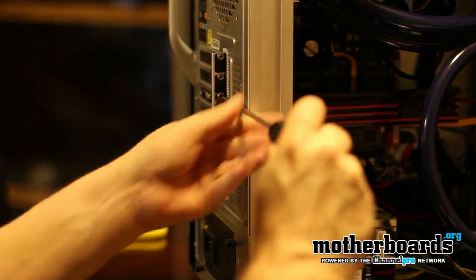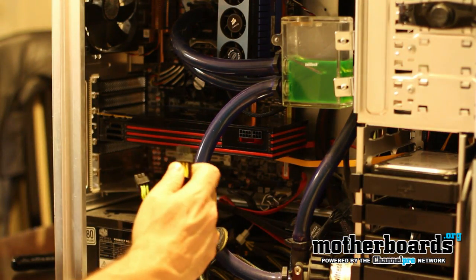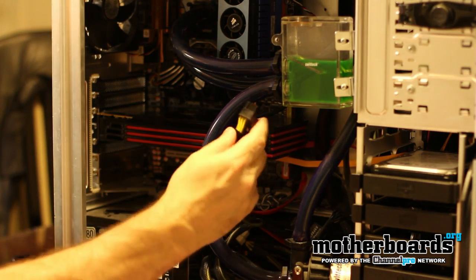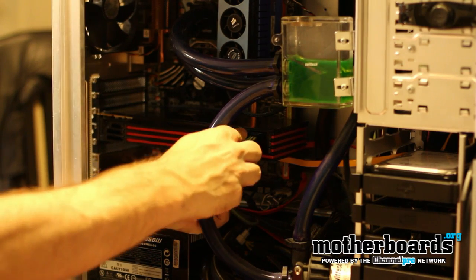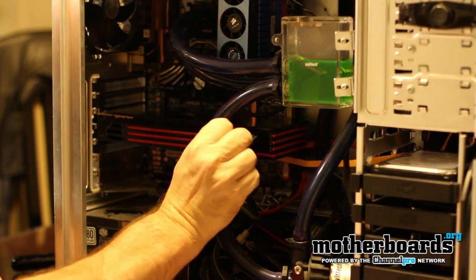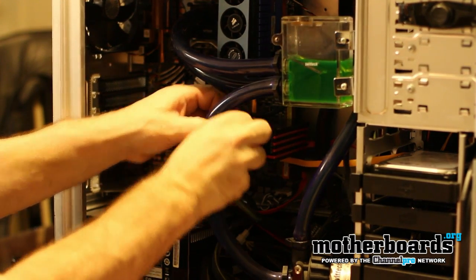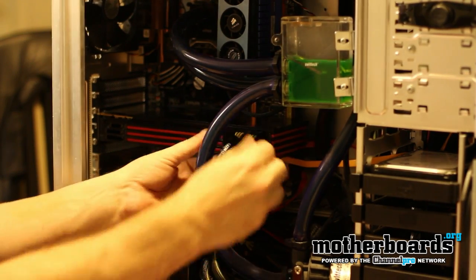This allows the video card not to pop out when you put the cables in the back or install the cables. Last but not least, we're going to install the 6-pin and 8-pin power connectors. We'll start out by installing the 6-pin — very easily plugged in — followed by the 8-pin. Now if your power supply doesn't have these two cables, there are adapters that go from Molex into these, but it is preferable to use a power supply that does support them natively, as that will most likely support the power draw of your card. Now we have the 8-pin and the 6-pin, so that wraps up the installation.